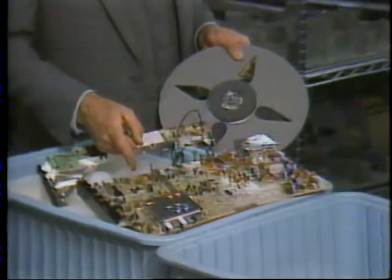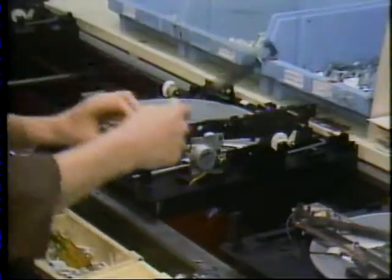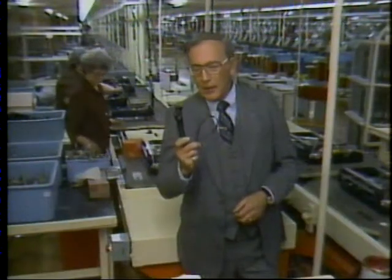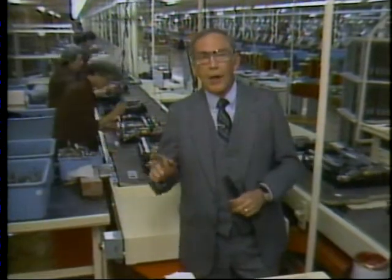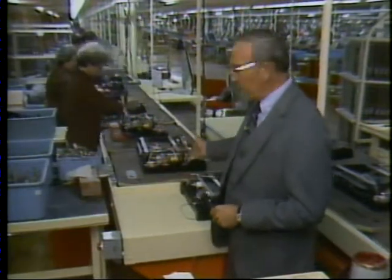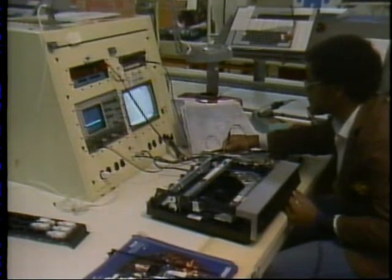The turntable joins forces with the master processing board and the pickup arm. It will be magnetized to allow it to operate with the motor drive system. Then its height must be set, the automatic loading mechanism assembled, and the power transformer added — not to forget the power cord. This final line procedure is called stop station assembly. Total player production is dependent on the speed of the slowest process on the line. The player is conveyed on a special table with its own power outlet, enabling each player to be tested at several points during assembly. This troubleshooting station keeps a running log of any problems, and the information gathered can be used to track performance standard trends.